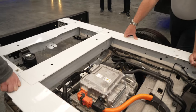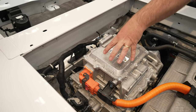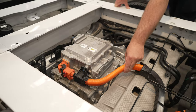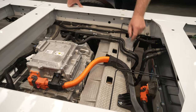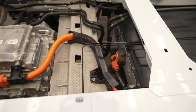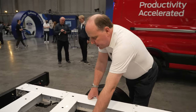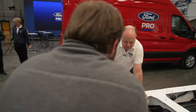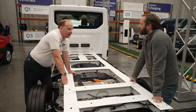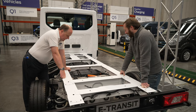The little box on top is something we call an ISC — basically an inverter. What that does is take the power from the battery; this massive cable is the energy out of the battery — 400 volt DC — and it turns it into AC that the motor can then use to spin. The motor here is 198 kilowatts with 430 Newton metres of peak instantaneous torque.